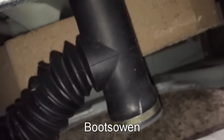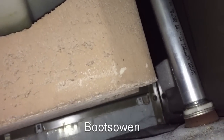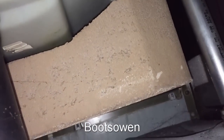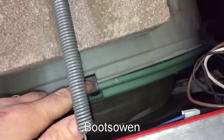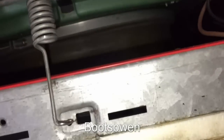There's another video up on YouTube of how to clean that filter basket. If you look down at the bottom, it's got some kind of shock absorbers — gas strut kind of things — and a massive lump of concrete fitted to the bottom to counteract that weight up on top. Even though it's a pretty basic model, it does have a removable clip-on front to the plastic tub, so you can take it completely apart to get at the bearings.